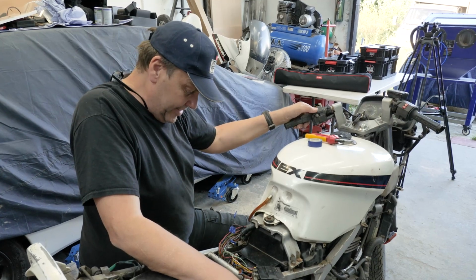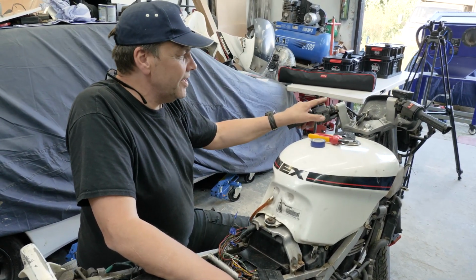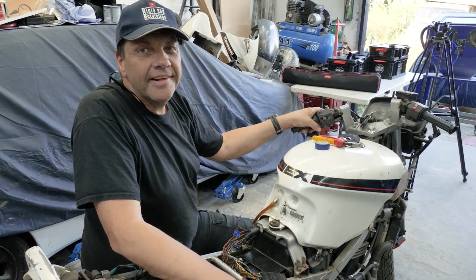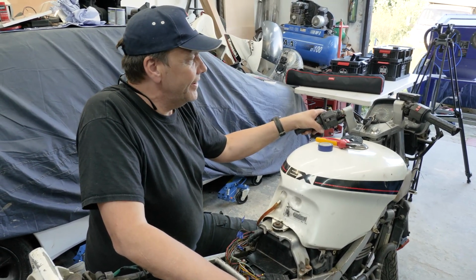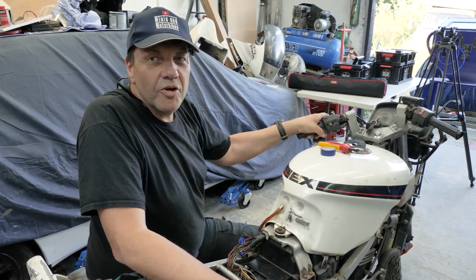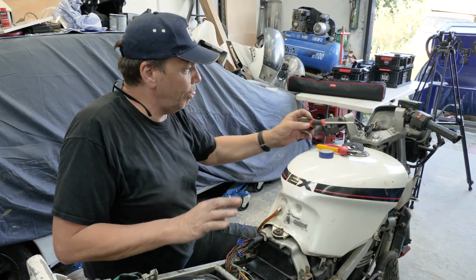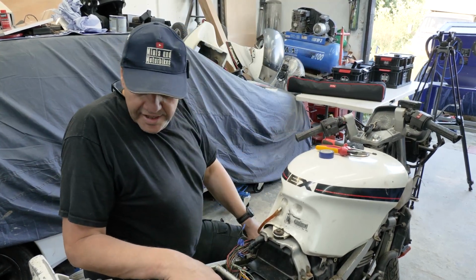Yeah, I've isolated the immobiliser. And you still got nothing? Still got nothing. It's got to be the ignition barrel then, isn't it? What could be wrong with the ignition barrel then? Well, apparently they shake themselves to death. All the vibrations in the end, all the plastic bits just break off and go inside, so, yeah.